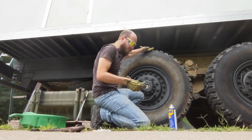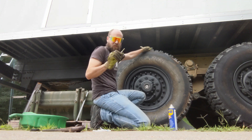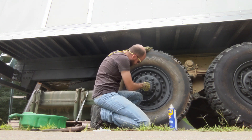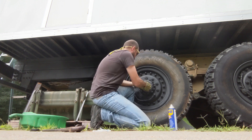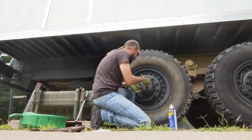Now, where it gets easy on the street side — the easy way to get these out is to get just a standard three-eighths bolt. You're just going to thread that into the end of the axle here, like so. Then you just pull on it. Holy shit, that was way too easy.